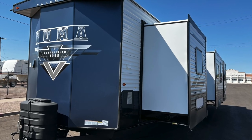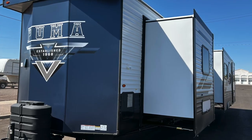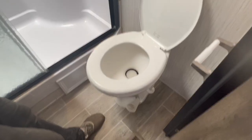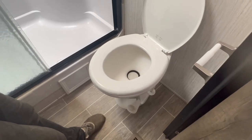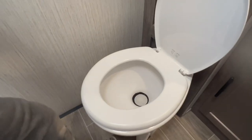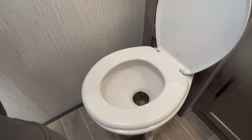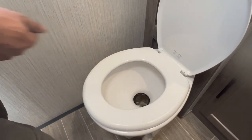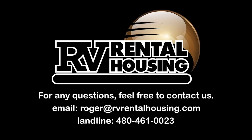When receiving your new trailer, the tanks are often sent completely empty, allowing a plastic smell to accumulate throughout. Tank seasoning is the process of introducing water and chemical packets — Fortapax — into the tank to season it for later use. Step on the flush pedal, count to 100, and drop in a tablet. You'll need to season the tank every time you empty the black tank or your waste service company empties it. The four to five gallons of chemical water will help dissolve waste and RV-only toilet paper, and also help reduce odors.